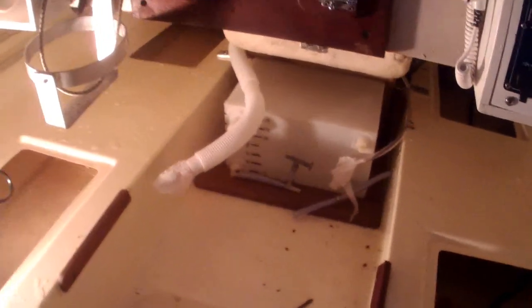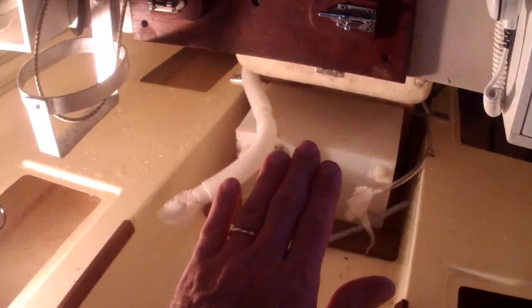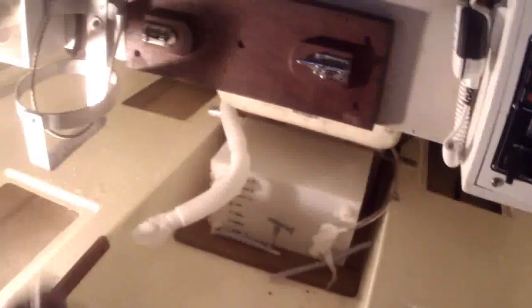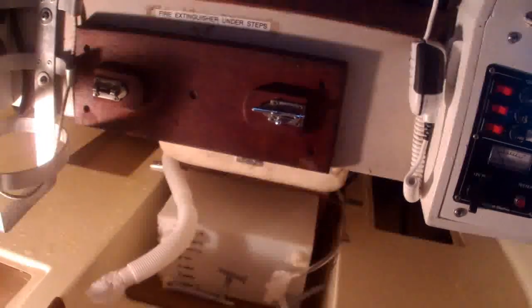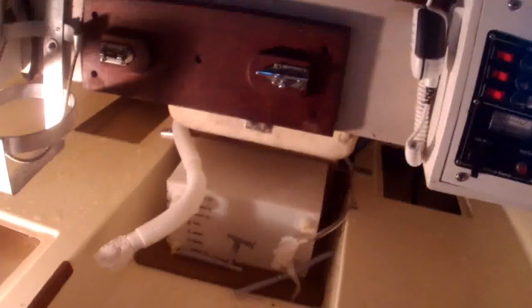So when we pulled the boat the first time, I went under there and took the water tank out, and I realized I had to flip the tank because I had all the inlets and outlets on the back. I didn't realize it really does pitch up, so I could never get the last 2 gallons of water out, so I had to spin the tank anyway. I checked the screws. They looked like they were close to the bottom of the hull, but none looked like they were in contact. But I backed them all out to be safe, got out my bolt cutters, and clipped them all about 1/8 inch, took the point off, not quite 1/4, but around 1/8 inch. Put them all back in.